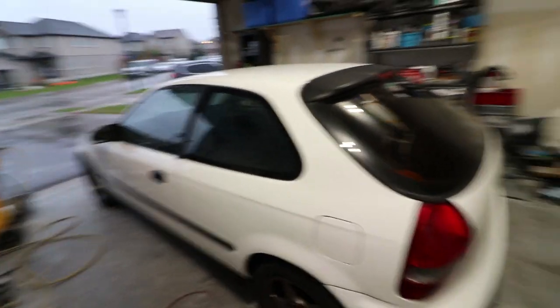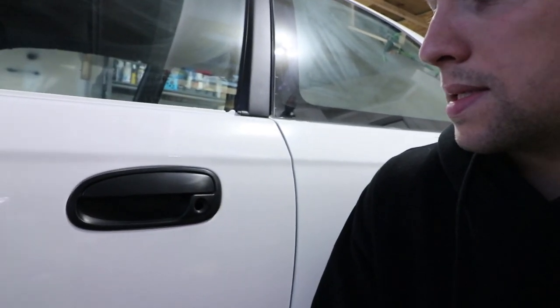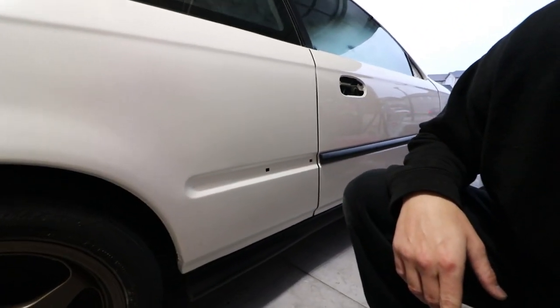Things are assembling quite nicely. I'm really liking how the rear tail lights came out, and going with the black trim — the flat black just looks so much nicer. One thing I did as well: instead of respraying this I ended up just sanding it down with 1500 and 2000 grit, because if I respray it I feel like over time fingers, keys, or anything would just start scratching that paint a little easier. I'm actually debating on putting side markers on the front fender — it might be a nice detail, though I should have thought of that during bodywork and paint. One thing I do have to cut open is the clip piece for the side trim — something I overlooked during bodywork entirely. I'll just go in there with a Dremel and be careful not to damage anything.